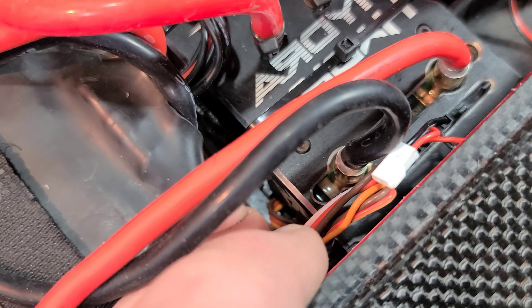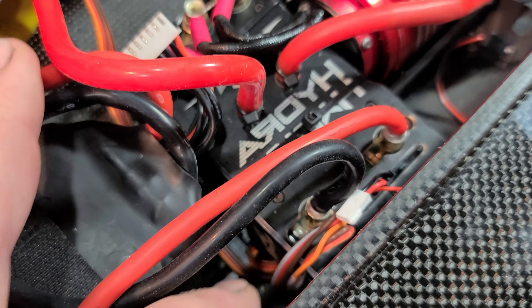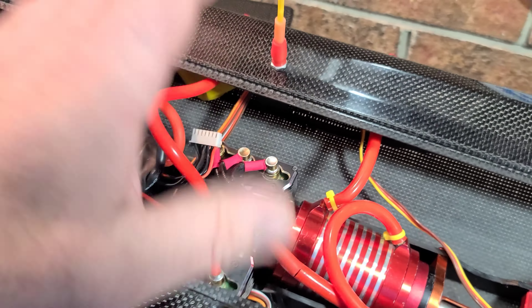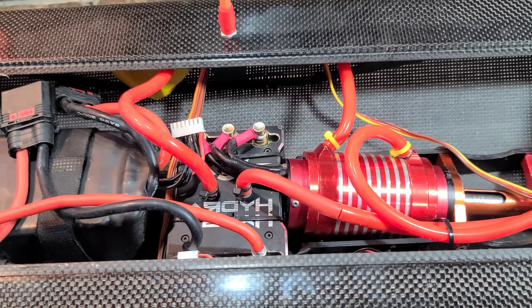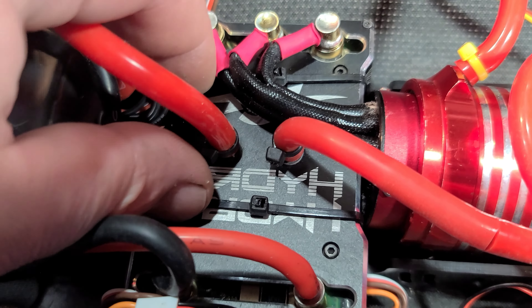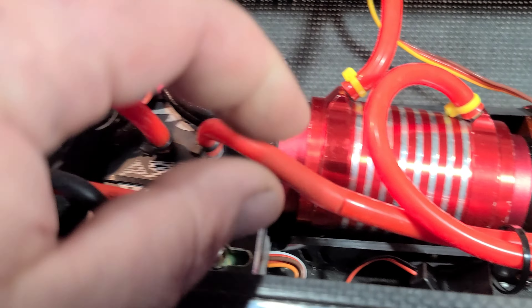I've got my ESC wires running out to the receiver and doubled up all the excess — there's like 15 feet of wire coming out this ESC, so I put heat shrink over it and tucked it under the ESC, using the wires as a cushion buffer. It's not quite touching the bottom but it's close. I double-secured the ESC with zip ties so it won't go flying. I spliced in a cooling line and should probably add a zip tie around it so it doesn't blow off at high speed like it did on my 42.